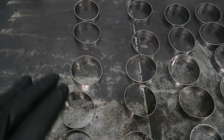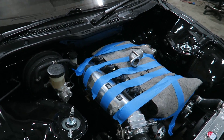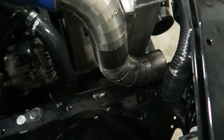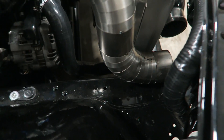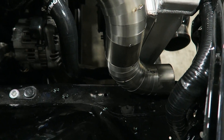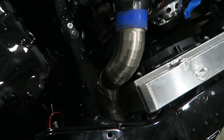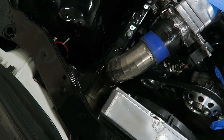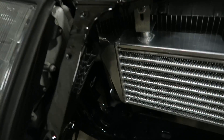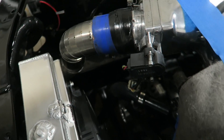Each one of these sets here is five pies. Those five pies equal 45 degrees. So if you take two of these and put them together you get a 90 degree elbow — it's like a math problem. We got the entire intercooler pipe for the intake side all mocked up and tacked together. There's going to be a ton of welding — I want to say there's 10 down there and 8 up here, so 18 pie cuts in total. You can see how nice it actually fits right next to the radiator, not touching, and it's going to come out right there to a 90 degree coupler.